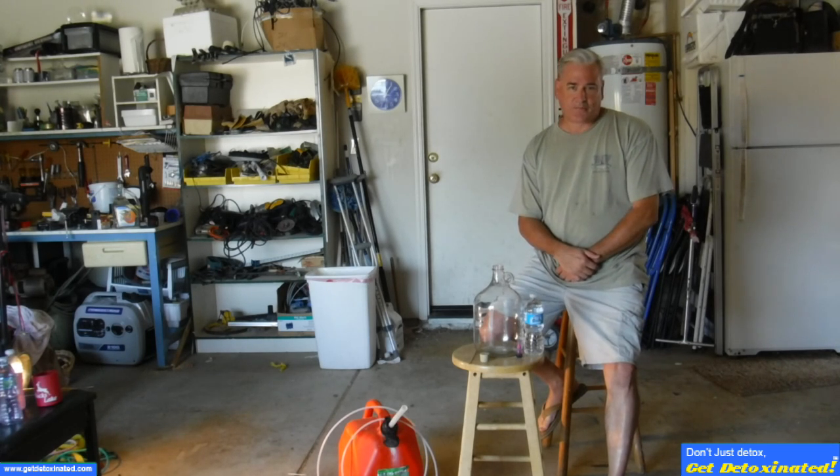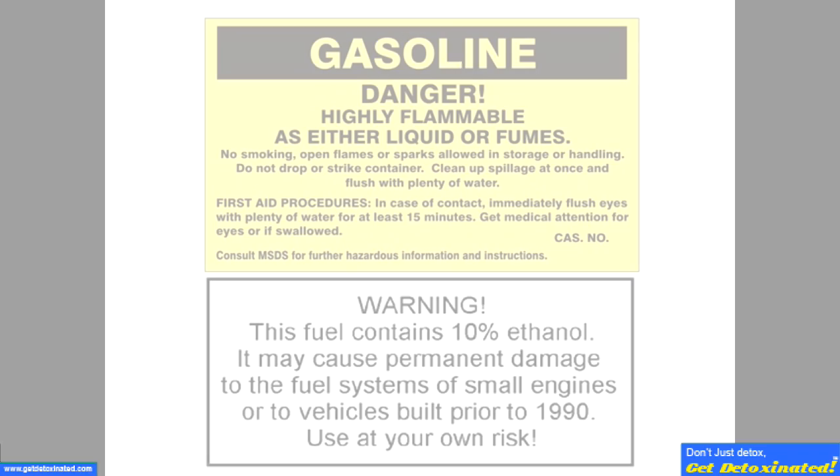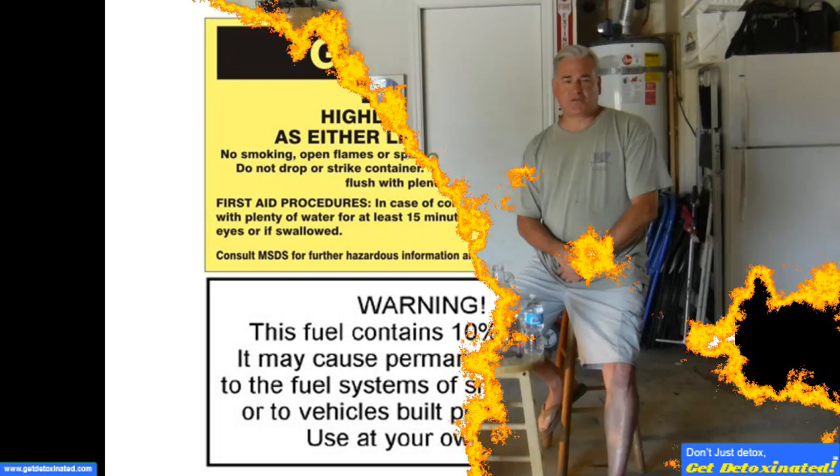Hello, I'm Daniel Root, the Pragmatic Prepper. I'm going to show you how I remove ethanol from gasoline. 90% of the gasoline sold in this country contains ethanol, known usually as E10 gas. Ethanol is an alcohol, and alcohol is known to deteriorate your rubber hoses like your fuel line and gaskets. It also dissipates oil, so in your two-stroke engines you'll get those engines running really hot. I've already gone through a lawn mower, a weed whacker, and a generator because of ethanol. So I decided to figure out how to remove it, and I'm here to show you today how I do.